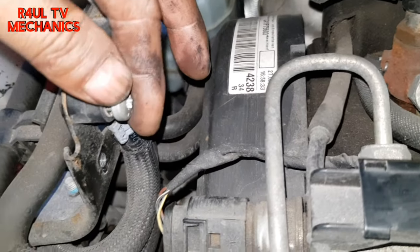Okay guys, we've run it through for about 5-10 minutes. What we're going to do now is phase 2 — we're going to take that pipe off again and use the proper stuff, the DPF cleaner. Get that down there, then we'll regenerate it. The moment of truth — I'm going to spray some of that in there. Pipe into that and spray it. It's going somewhere. We'll also spray it into the O2 sensor hole where we took the O2 sensor off. Let's get it down there as well.